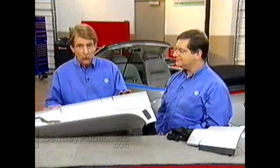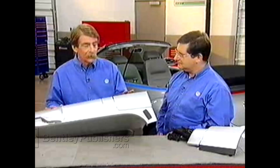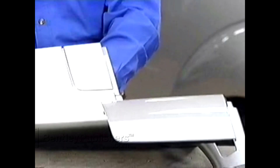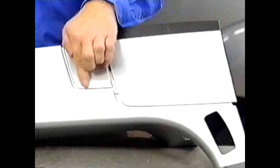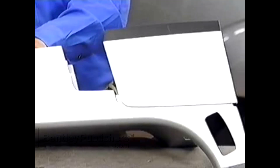Take a minute to look at the side panel before putting it back in the vehicle — once the side panel's back in, you can't make any adjustments. There are two movements to the side flap: the rear portion lifts up, controlled by a motor; the front portion is controlled by a cable attached to the roof that pulls the side flap forward and underneath the side panel. What's critical is that all the gaps along the flap are even and the height of the flaps matches the height of the side panel. It's very important that when the front portion slides forward it's low enough to clear the side panel, or it will scratch the surface. Note that there isn't any service repair information describing this adjustment, so check frequently for updates.